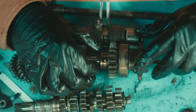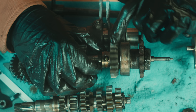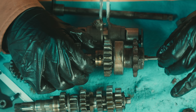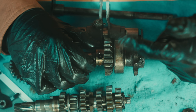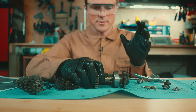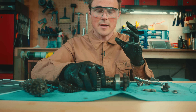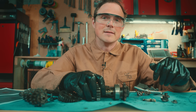Check this out. When the rod is pushed in, these balls are up and this gear can spin freely — that's going to activate one gear set. When I pull the rod out, that ball drops in and this one locks into place, which allows an entirely different ratio of gears to be running. This is how, with one motion, we're able to engage and disengage completely different gear ratios for climbing or for traveling at high speeds. It's so simple, durable, and I love it.